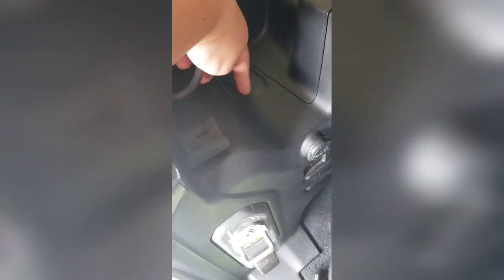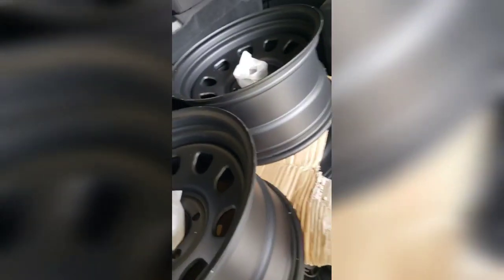For the brake light, first you want to take out this covering. I use a flathead, but a lot of people use an actual cover remover. It's pretty simple - you see the gap, you just press it in, pop it up. And no, it didn't scratch it.